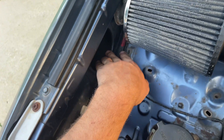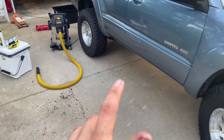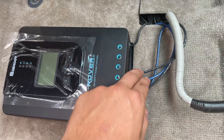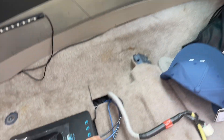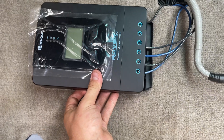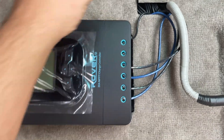Might also get a fan in this hole because this is where the original intake goes, to draw some more cold air in. Now I'm going to do a voiceover of the clips I took while installing this to further explain how it works and how everything's been routed throughout the car. Here you can better see how the solar charge controller is mounted underneath the passenger seat. It's a 30A charge controller, which is a bit overkill for my situation, but two solar cables go through the footwell and through the firewall into the engine bay, and two battery cables go under the carpet to the negative and positive bus bars in the back to charge the battery. The charge controller itself is backed up to the footwell's air conditioning to better cool the heatsink, since it is mounted horizontally — you're supposed to mount these vertically to help cool them better.